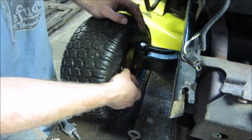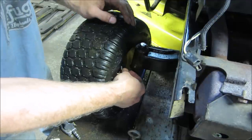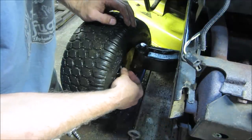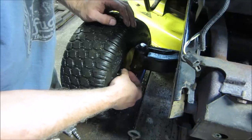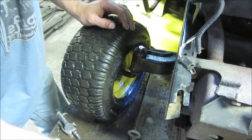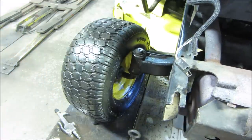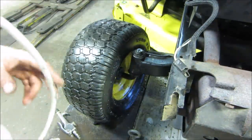If anything, you actually kind of want to draw in a little bit, but you just don't want air pushing back when you're trying to fill it. So you want to take all of it right out, because you are trying to push a heavy fluid, and you want the stem out of there so it can travel around it, because air can travel around a little valve, no problem.